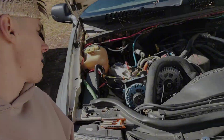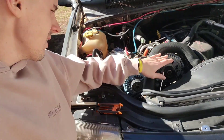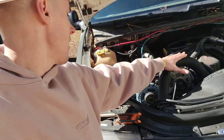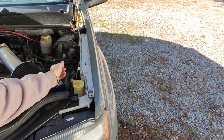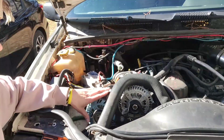It's the next day. We came back to figure out what's going on with this CES alternator — it's just not putting out enough power. We think the issue is that one alternator is internally regulated and the other is externally regulated. Over here I have a switch and a knob where you can tune the externally regulated alt. We think they might be fighting against each other.